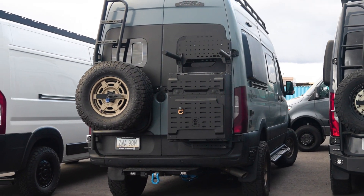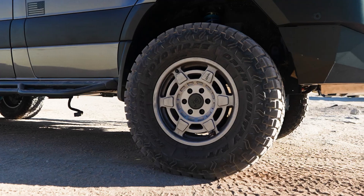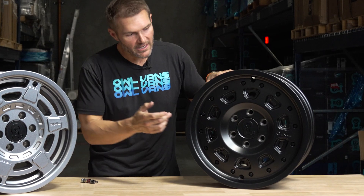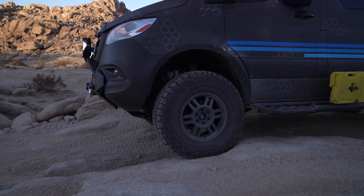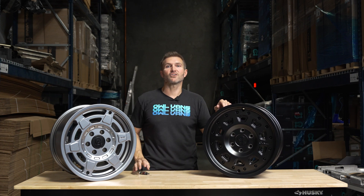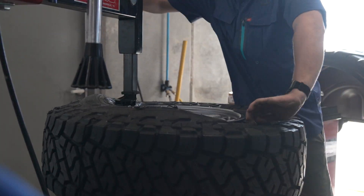What separates OWL wheels from the rest? First and foremost, function — it had to be strong. A lot of the wheels out there are made for pickup trucks because molds are expensive, so many wheel manufacturers take a wheel blank and re-machine it for different vehicles. What you end up with is a 10,000-pound Sprinter on a wheel rated for 2,500 pounds. Multiply 2,500 times four and you're right at the load limit. So the first thing we wanted to do was double that load limit — we didn't quite get double, but we're close, at over 4,000 pounds per wheel.